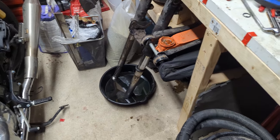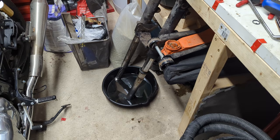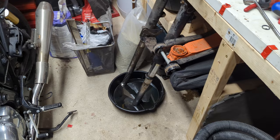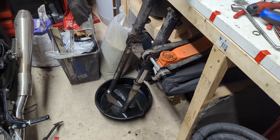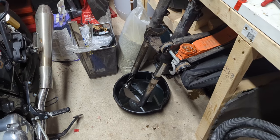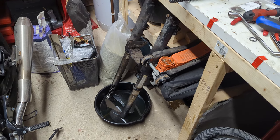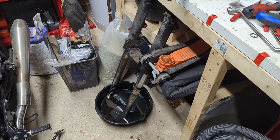At this point, if you've never worked on motorcycle forks before, you're going to find out that fork oil smells disgusting when it's been sat for a long time in some rotten old forks like this. I think it smells like mouldy dog food — really bad corned beef mixed with gearbox oil. So there's a lovely mental picture for you. I'm going to leave these upside down like that overnight to drain out, and then we'll take the bolts out the bottom of them.